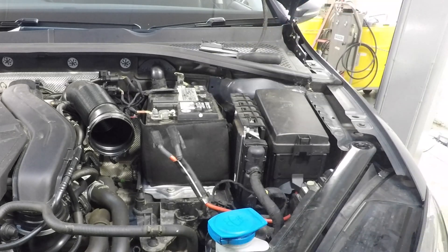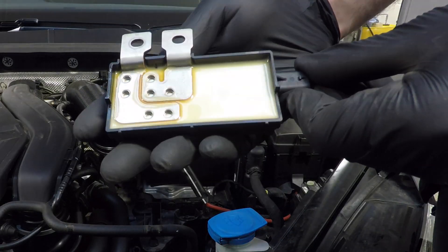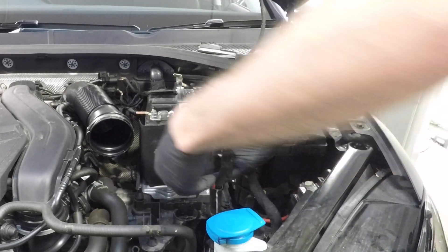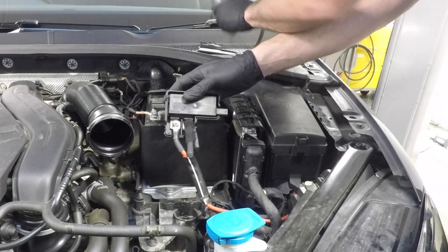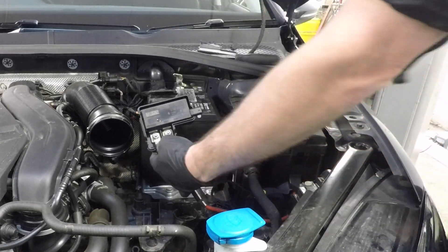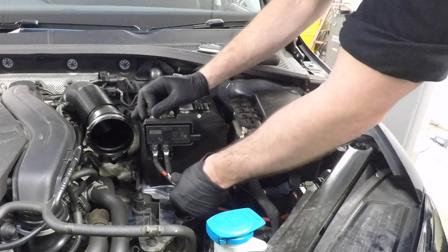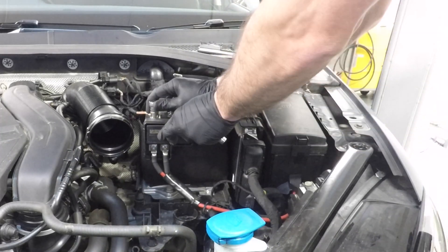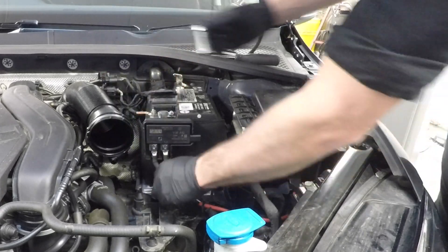In a standard vehicle, if the engine was switched off the vehicle electrical system would only be supplied with power from the 12 volt battery in the engine bay. For this reason an additional battery has been installed to ensure safety-related systems such as the lighting, power steering, and brake regulation continue to be reliably supplied with power. The additional battery is a 12 volt lithium-ion rechargeable battery located under the front left passenger seat, and it's only connected during the coasting function to supply the entire electrical system with power during this time. The original 12 volt engine battery will only be used again for restarting the engine if needed.